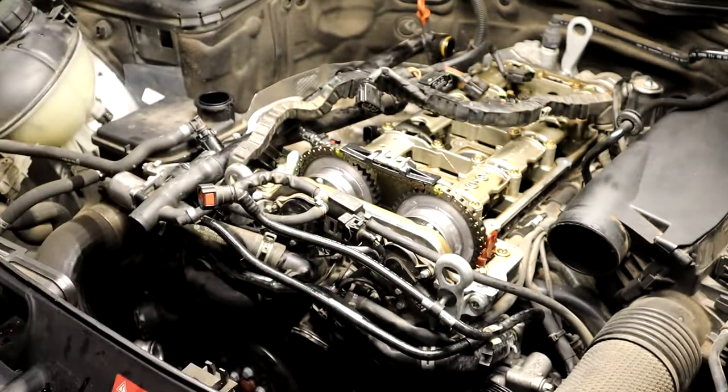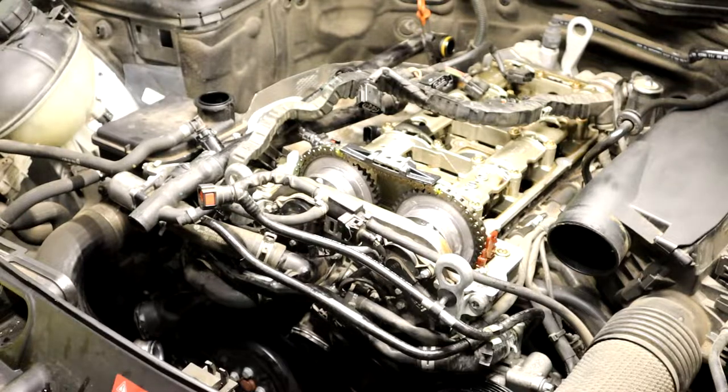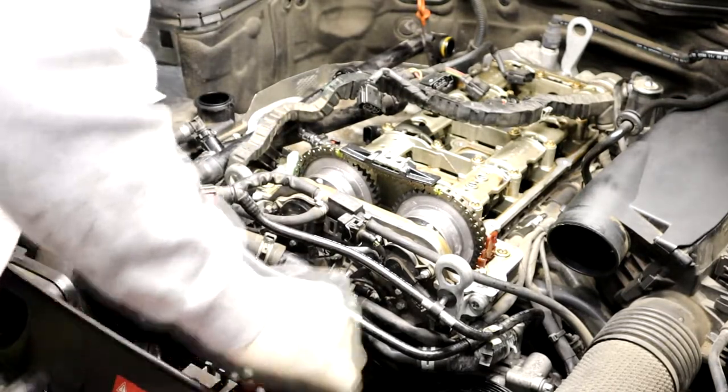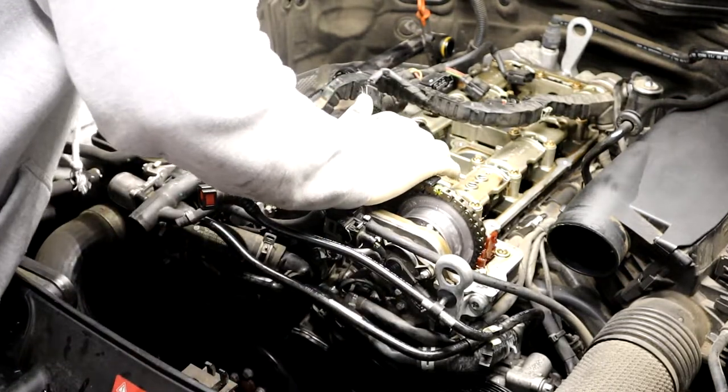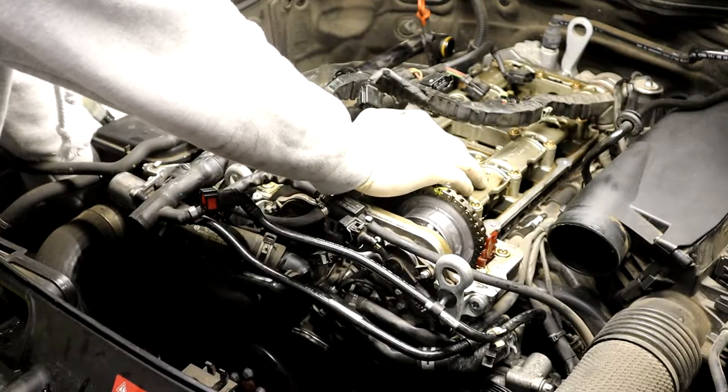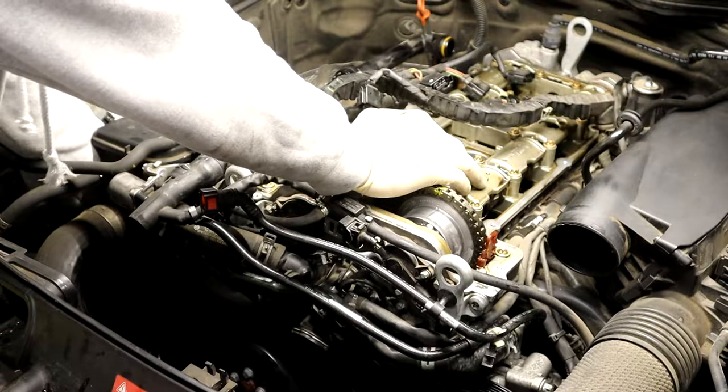All right. So you put the alternator back on already. I did that off camera. I just threw it in. Way easier from the bottom, so if you're gonna do it, do it from the bottom. The lower bolts were super easy from the bottom. I think that's what I usually do, is do the lower bolts, then the upper bolts.